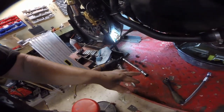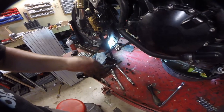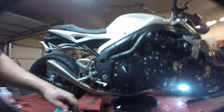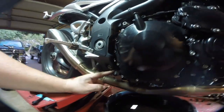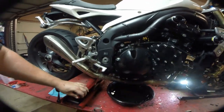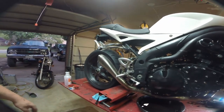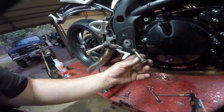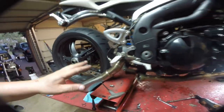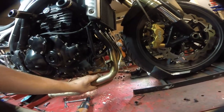There are six nuts total - they're really easy to remove if you have a swivel U-joint style adapter and an electric wrench, or do it by hand. They take a 13mm socket. Now all of those are off. Over on the right hand side of the bike there's really nothing that attaches this exhaust except for this bracket, which is also a 13mm socket. We can remove this and the entire exhaust can come off, but we're going to separate them. There's a clamp back here - we're going to separate these and leave the rear piece on because it's got an O2 sensor and we don't need it. There's a 12mm bolt here with a non-captive nut on the back - kind of a pain to reach. This is just a slip joint. This should just slip right out.